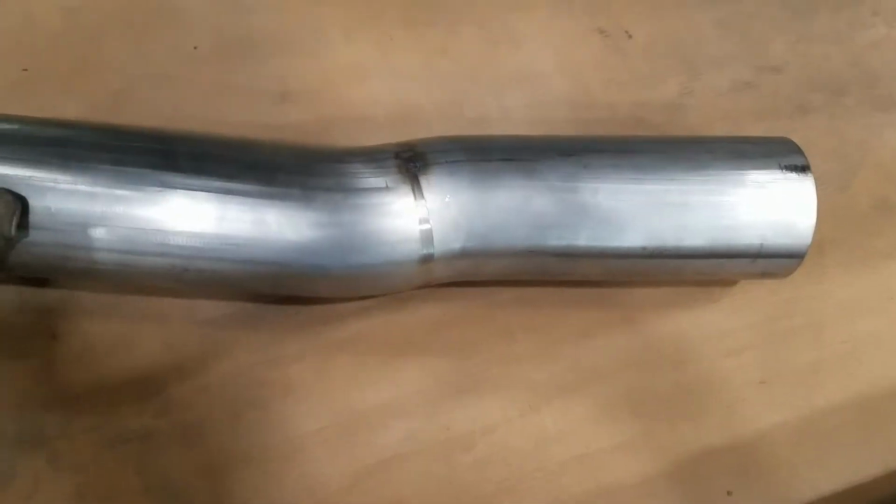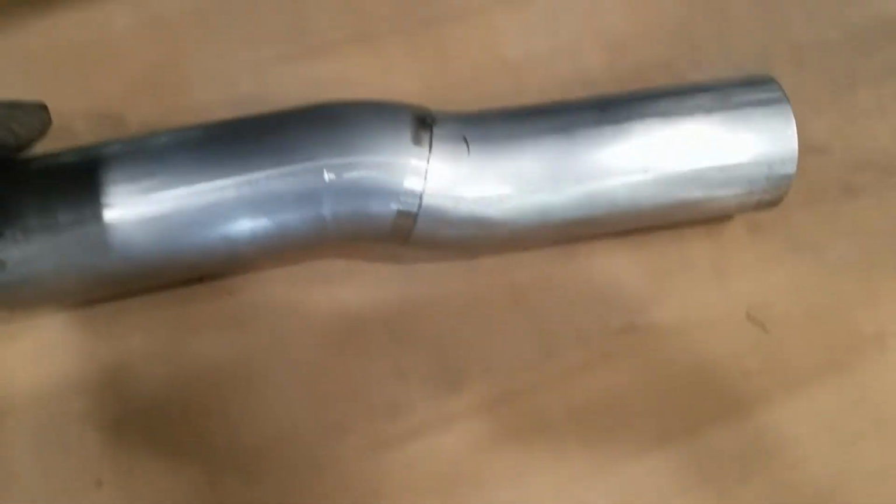Here is this. So I cut one of the 45s and tacked it where I think I'm gonna get the best. Yeah, tack there and tack there. Don't forget that. I had the tube slip out of my hand while I was tacking it. So, let's see. Throw my gloves back up under there. Snaggle my way back to this. I do have the new flange on there. However, it is not bolted permanently.